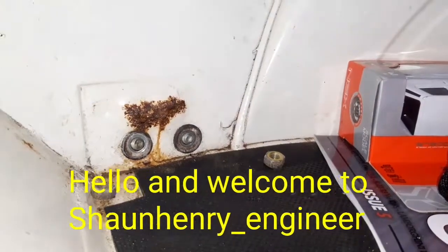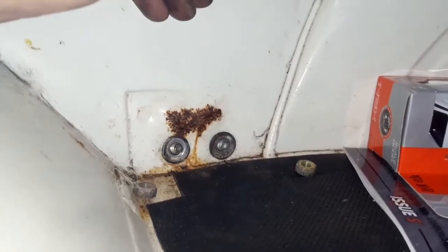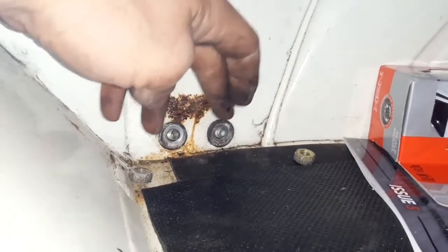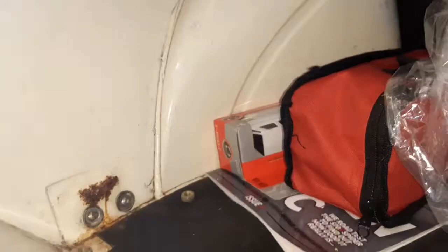Today I'm taking the bumpers off of the Mark 1.5. These are utterly simple, not gonna lie. You've literally got 6 bolts overall from what I can see. You've got 2 bolts here either side in the boot area, like so, and there's just taking the nuts off of those. And inside of those is obviously some bolt heads, which are under here in the rear arch, like so.